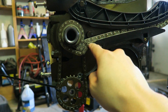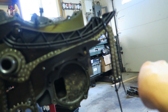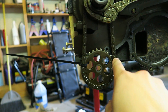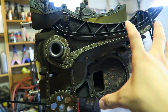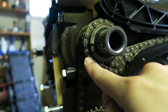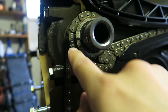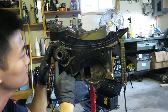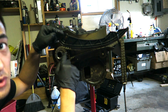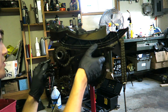As you can see, here's the primary chain for the actual exhaust valve, and then the secondary chain on the Vanos actually goes right there approximately. You can also see the oil pump sprocket just dangling there. Before I take apart any of the guide rails or anything like that, I'm just going to quickly mark the chain. I marked with a sharpie right where this little dowel pin will fit on the actual sprocket itself, and it will line up to that little circle. It seems like I can pull the entire assembly off — there's a little clip on top that you just push upwards on to release it.